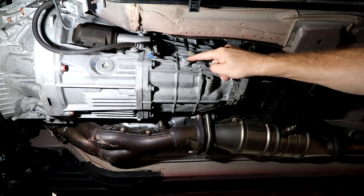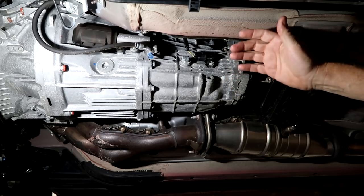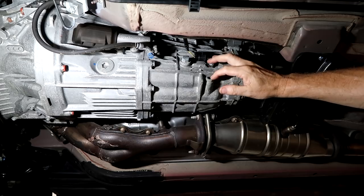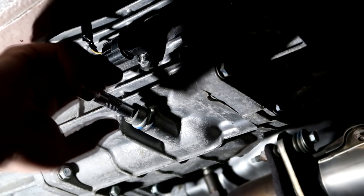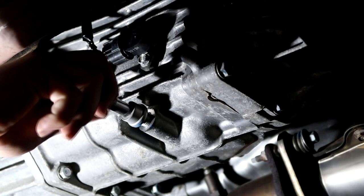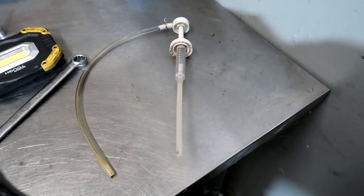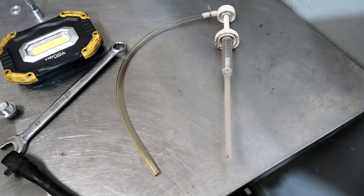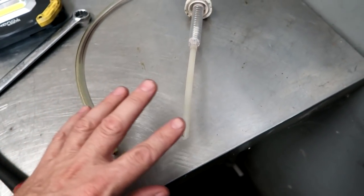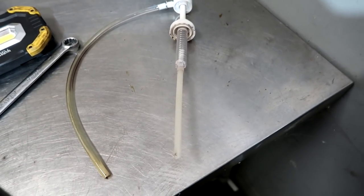Now, this is another tip: always break the fill loose before the drain. That way, if there is a problem with this, you're not driving around with no fluid — you're not going to strand yourself. So break the fill loose first, then drain. For the drain, another trick: use a 3/8 extension — gives you a little bit more room to back that out before the fluid comes out. You're going to need this hand pump right here. I'll put the product list in the description so you can order one before you get started. Whatever fluid you use, if you switch fluids, always put it in new fluid and pump a little bit through to make sure the old fluid doesn't circulate back into the bottle.